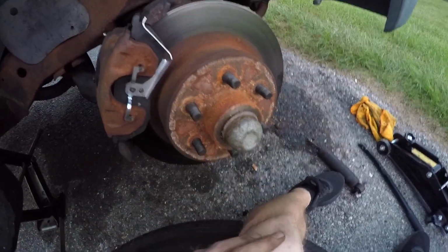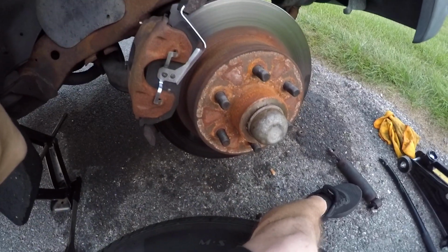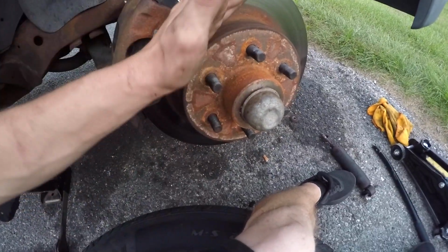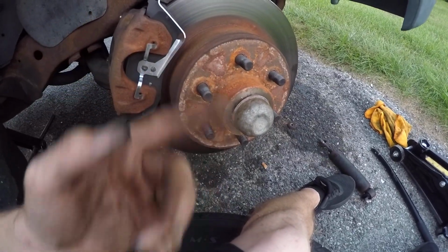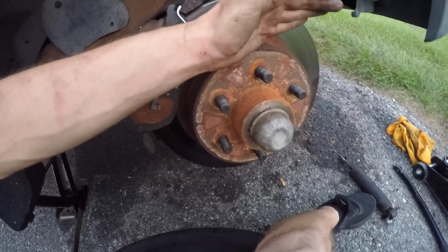You're going to have to go ahead and take the lug nuts off. They're usually 19 mil for the 6 lug pattern. You could probably switch up lug nuts, or someone could swap them out. You know, 19 is not a set thing. If someone's been in there messing with it before you, it might not be a 19. It could be a 21, 22. It could be like a tuner lug setup with splines. It's a 19 though. 19 from the OE stuff.